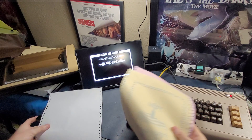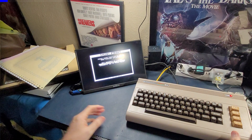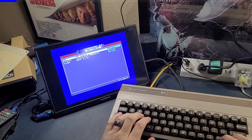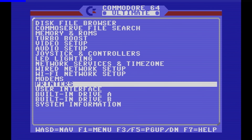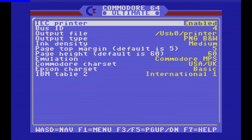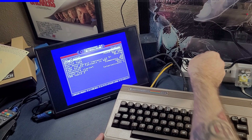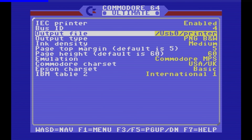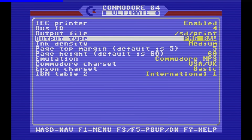Even though the ink was a huge failure and I bought paper I didn't expect to be useful, we still got a pretty good demo out of it. Now I know what you're thinking - you're not hooking up a real printer, but there's got to be some way to do a virtual print. Of course there is. We're going to use the exact same picture so you can see what it looks like. Going into the freeze menu, go to the printer and turn it on. Here we go - we can set what bus ID we want. I'm going to unplug the real printer so there's no possible conflict. Where do you want the file to go? Let's try SD slash print.